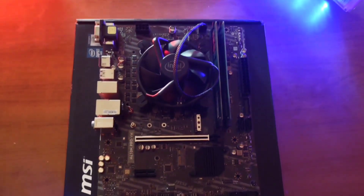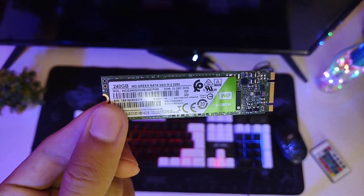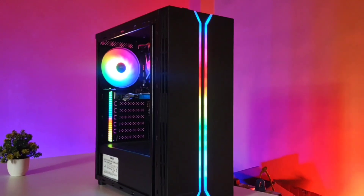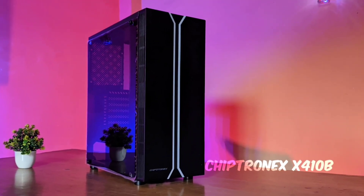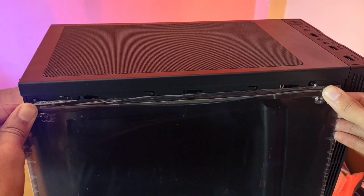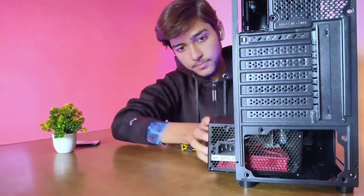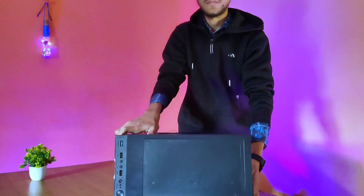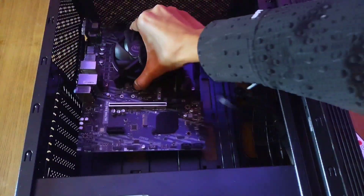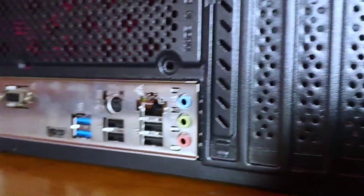At this point the motherboard is almost ready, and we just need to move everything into the case — install the power supply, graphics card, and other necessary components. First, we need to prepare the PC cabinet. This is a Chiptronex X410B, which has a specific place for the power supply. I installed the PSU by removing the back panel cover, then inserting the power supply into the case while making sure the fan is facing downwards. I then flipped the case on its side, placed the motherboard in position, and secured it with screws so it aligns perfectly with the I/O shield at the back.